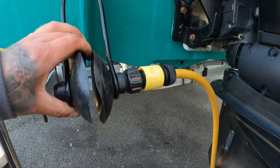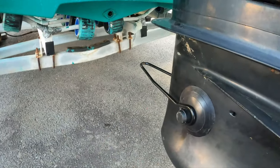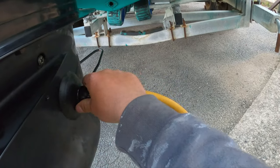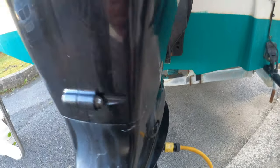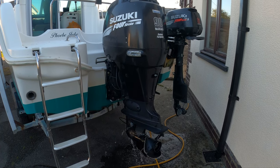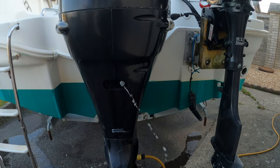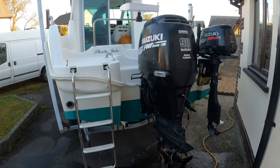A pair of muffs attaches to your conventional hose attachment and literally slides on just like that. You can get ones which are double-hosed — they are better. This is a cheaper one; it hasn't got a hose on this side, just the other, but it still works fine. It's just a cheaper setup, so that's going to squirt water in there. The other side's blocked so the water will stay in there, it'll suck it up, and it should jet out up here. Make sure it's jetting water — as long as that water's running through the engine, it'll keep it nice and cool.